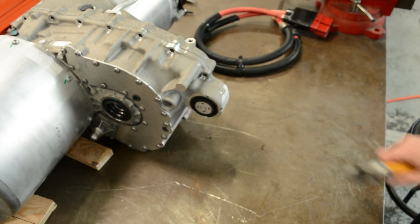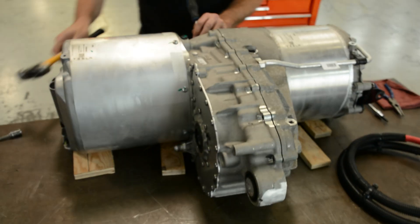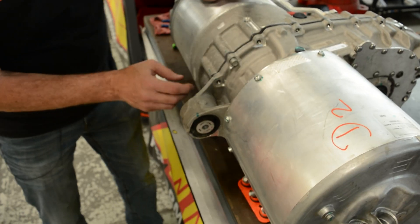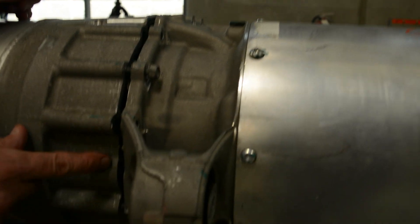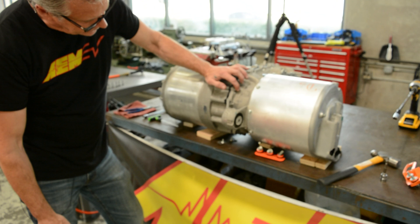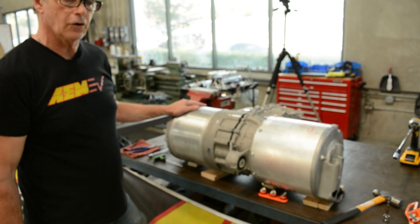Now we have the cases slightly split. I'm staying at the bolt head areas and not putting the screwdriver in between the machine surfaces. You can hear the change in tone — it's sort of like a hollow dump-dump. Now there are big, beautiful alignment dowels in here. And if you look inside, there's our friend just behind it — see this white cable? That guy right there, you have to be so careful. I'm up against my bolt head, so this is the point where it's time to stop and transition over to the time lapse.